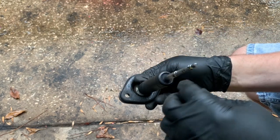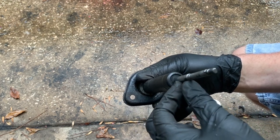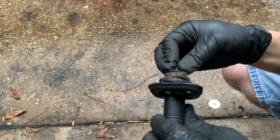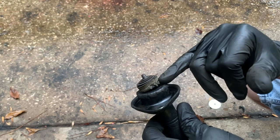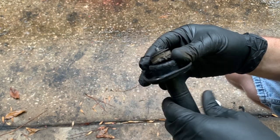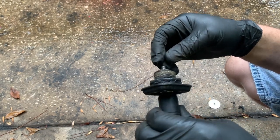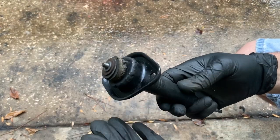Or I can find a different kind of rubber if needed - a thicker kind. I thought about using the same rubber pieces that came out of the original mount, but I didn't have any good ones left. I put the good ones on my car, so I decided to cut from the tire sidewall - it's a little bit heavier duty rubber, which makes this mount a little stronger so it doesn't move around as much. This should be a semi-solid mount that holds up well.